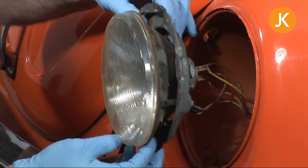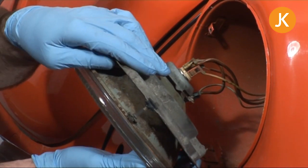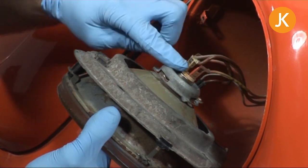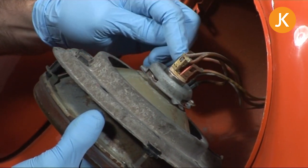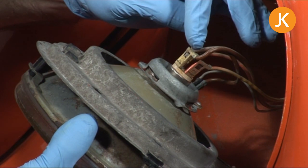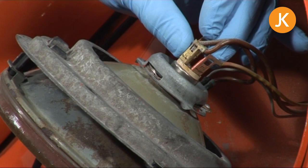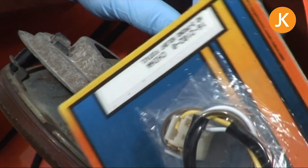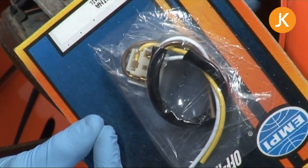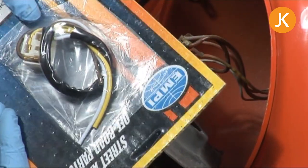As you can now see, this is the later style H4. If we flip it over you should have a little electrical multi-connector here with the wires going through it. Without that part, the wires could actually touch together, short out, and burn your wiring loom. We have a replacement connector here with a little bit of wiring loom on it — some body shops will literally chop through here when changing a wing, so you can use that or use a small screwdriver.